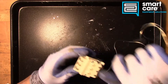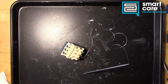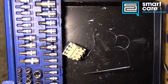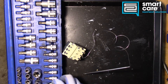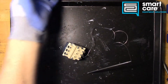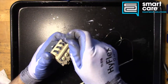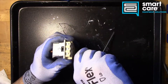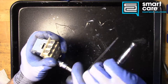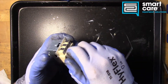Let's take it apart. We talked in a previous episode about Torx bits, so I have my security bit set here — these look like a T10. We also talked about this bulb system where you use fluid captured in a bulb with a cap tube to expand a small bellows, and that's what this is. So this is the bulb, this is the cap tube, and I expect we'll find a small bellows inside.